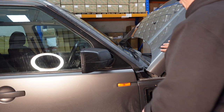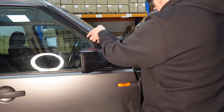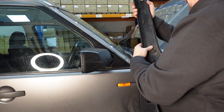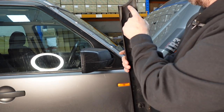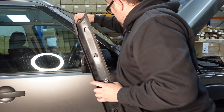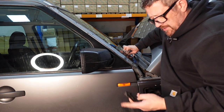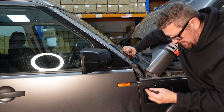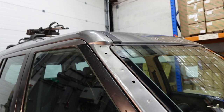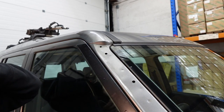Right, so we're doing it by the book. We've got our bonnet open and the instructions are telling us to remove this plastic trim on the pillar. It's literally just popped on. It's obviously been off before - I don't know if you can see that but it's missing its retaining clip at the top and the bottom. I can fit those clips back in. It also wants me to drill a hole to position a rivnut, but I'm pretty sure that is not where our bracket's going to sit - but we'll do as we're told.